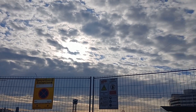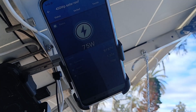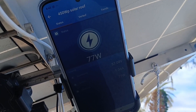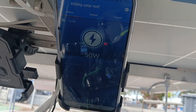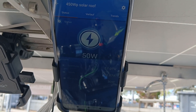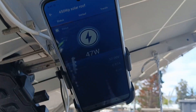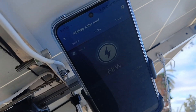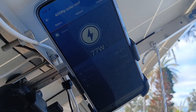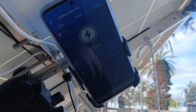The Sun is hiding behind clouds right now. It's 8:43 in the morning in Barcelona. With the solar panel tilted, we're seeing around 70 watts. When I move it to horizontal, it drops to about 50 watts. There you see the effect of a tilting solar panel — it makes a much bigger difference in direct sun. When it's cloudy with diffuse light, a horizontal panel position is actually best.